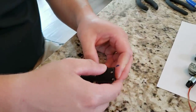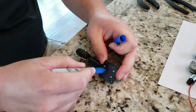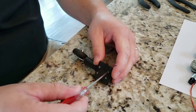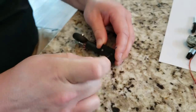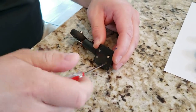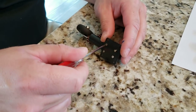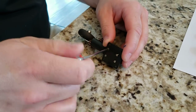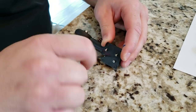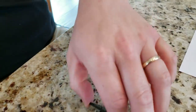more power to spare. Oh, I gotta take the bottom off too. Remember, this is just a spare part, so I don't really care quite as much, but I do still care, because you never know when you're gonna need your spare part to actually replace another spare part. And typically when you have a retract fail, it breaks the retract too. But look how sturdy that mechanism is in there. I mean, that thing is actually pretty well built. A lot of times the retracts, the mechanism holds up well, and what breaks is the electronics. There's some sort of a failure in the electronics.